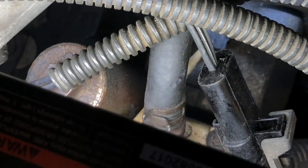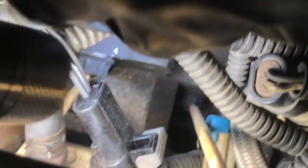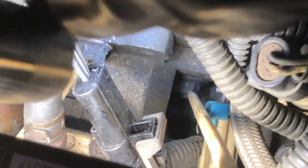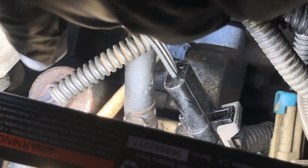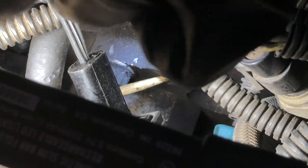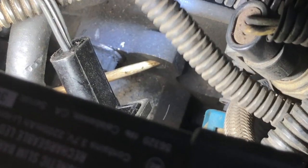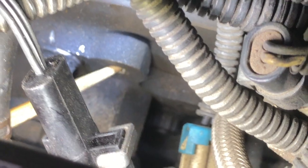It's very dark and cavernous in here. I'll pull some of the wire looms back — you should be able to see the top nut clearly, and with the flashlight you can see the left nut and the right nut similarly placed on the lower sides. On the passenger-side flange there are two holes visible, and those are important because the adjustment tool has to fit in those two holes.